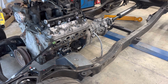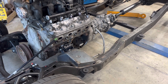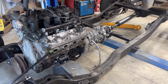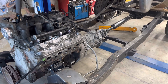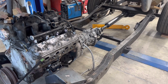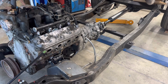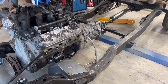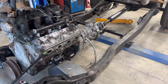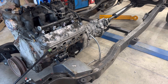I got a little sidelined. I ended up building the two front engine mounts — haven't connected the bottom yet — did the transmission mount, then set the pinion exactly with weight on it and went ahead and ordered the driveshaft. While everything was placed I tore into the transmission tunnel project, which I'll show later. I've now got enough in there and confirmed everything plays nice, like getting the headers in and out with the engine in.